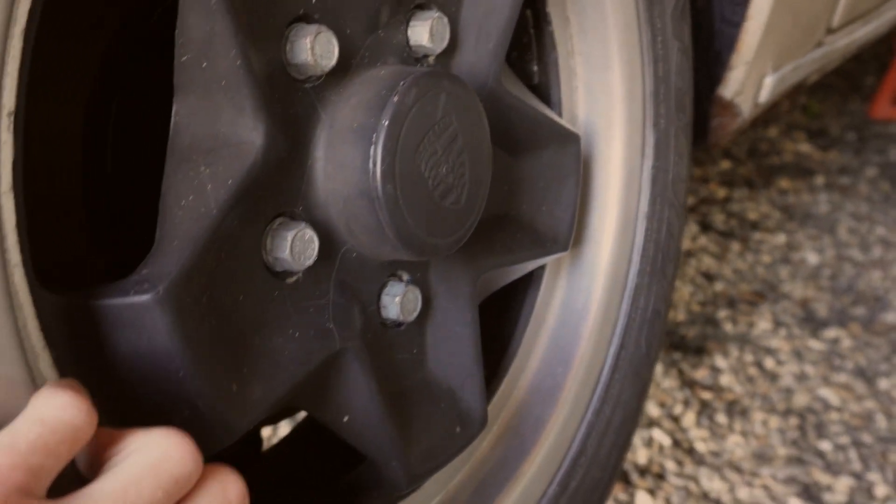The inside of this hatch here is a bit rotten but nothing too horrendous. The tailgate is actually at my friend's shop and he's made a start on getting it welded up — it is absolutely worse for wear, it is in such a state. The problem is we found when we took the rubber out of the window that the rubber had shrunk, allowing water ingress into the boot and absolutely destroying it. It was so rotten there's hardly any metal left on the inside edge where the window goes, and on the inside edge of the boot where it comes down to the rubber seal.